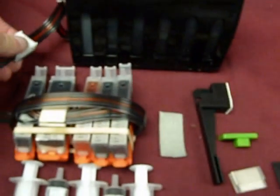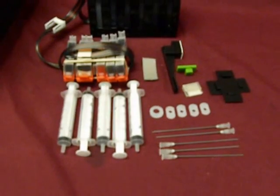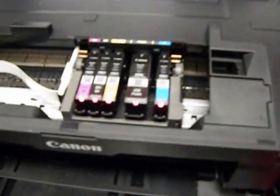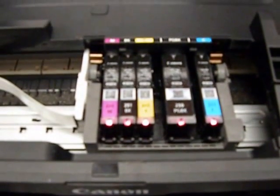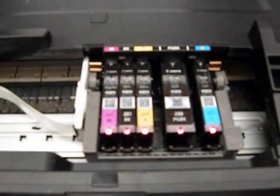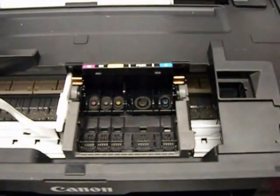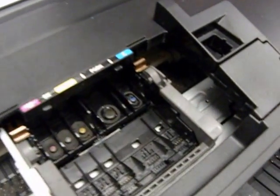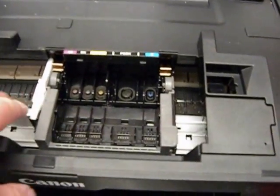You have your ink shutoff. All your parts and pieces will come with our Executive Series 3. I'm going to take the Canon cartridges out and then install our Continuous Ink System. I've removed the Canon cartridges and I'm going to reach behind the printer and unplug it because I'm going to have to do some hose travel.